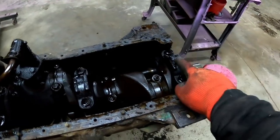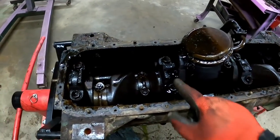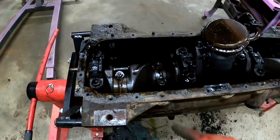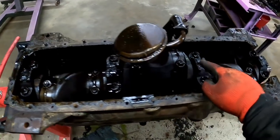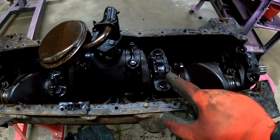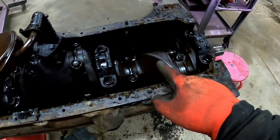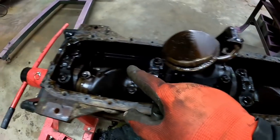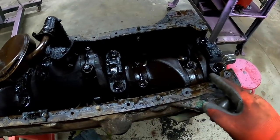That's just the mains in the block for those not familiar. The 1855 has one between each piston. You might ask why not have it on all of them — it's more iron, but probably the biggest thing is it's more machining, so it cuts down on cost. And when these were designed, engines didn't turn as fast, and it worked just fine.